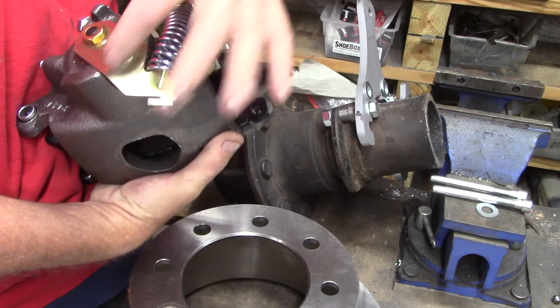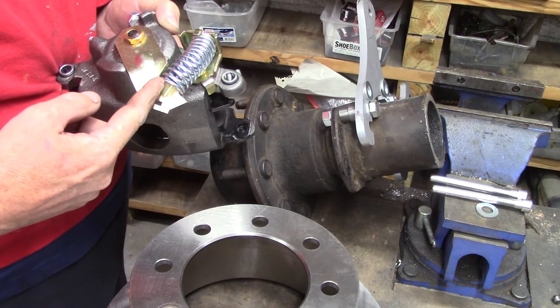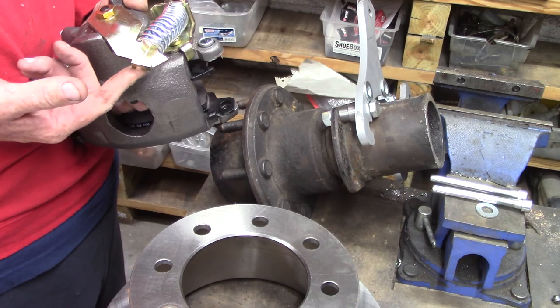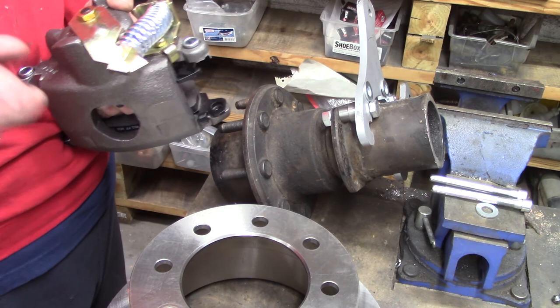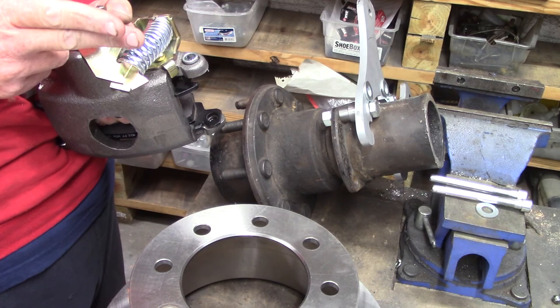You see that arm on the park brake? How does the park brake hook up? Your cable just comes through the spring, and on the end of your cable there's a little ball that's pressed — a retainer, or old school they soldered it on — and you hook it in there. If you need to shorten your cable, snip it with some snippers and re-solder the ball where you need to. God bless you, God bless America, and happy truckin'.